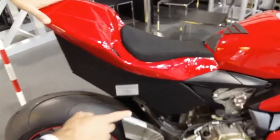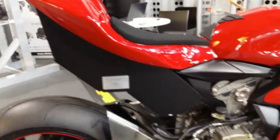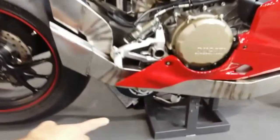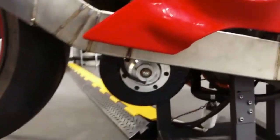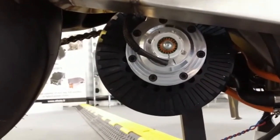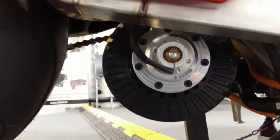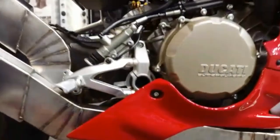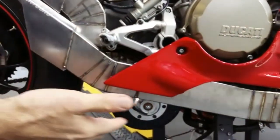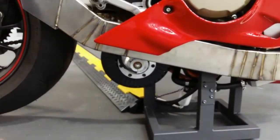We have installed a battery pack below the tail, and an electric motor — which is an axial flux permanent magnet electric motor — developing a peak power of 100 horsepower and a peak torque of 150 Nm, mounted under the bike while respecting the minimum ground clearance.